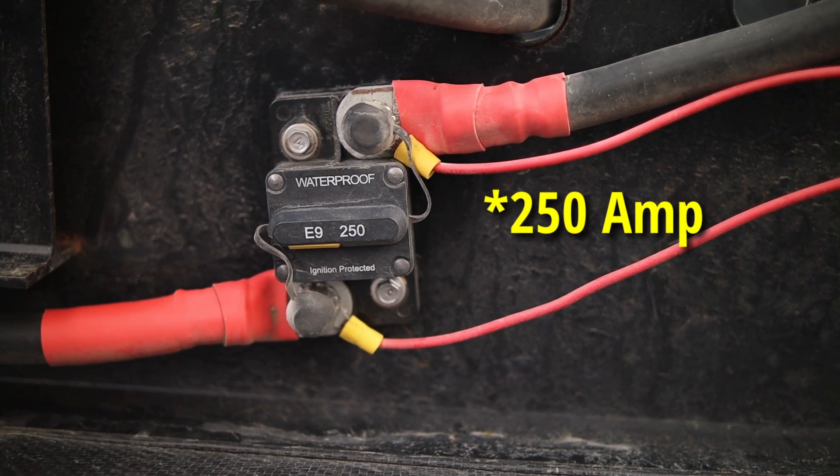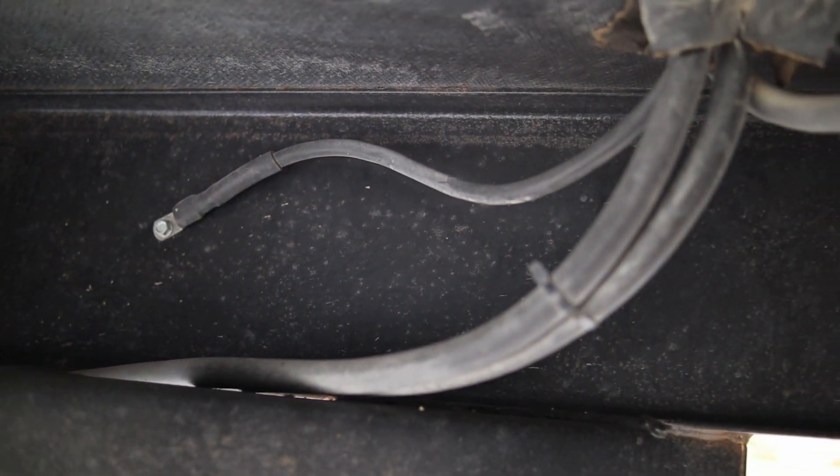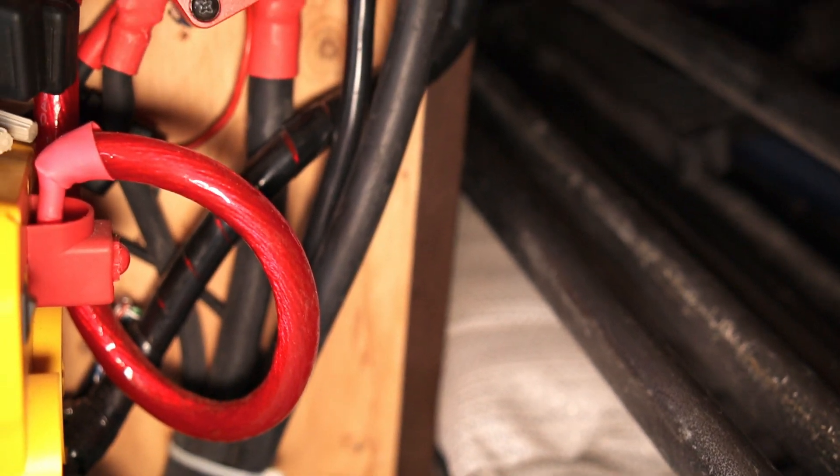I went with four-aught gauge cable. They only have it in black, so I had to put a shrink wrap cover over the positive side to indicate that it was the positive side. Because I'm going to be drawing extra amps, I wanted extra fuse and breaker protection at different locations throughout the camper. The first breaker I upgraded to was a 250 amp resettable waterproof breaker just inside the frame. This four-aught cable ran under the frame in a protected area to the nose of the trailer, just inside the first storage bay. Using the rule of thumb that shorter is better for 12-volt wiring, even taking the shortest route I could, I still have 12 and a half feet from the battery terminals to the first termination block.